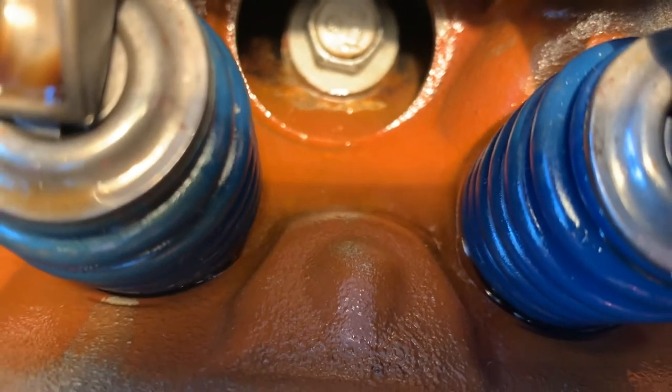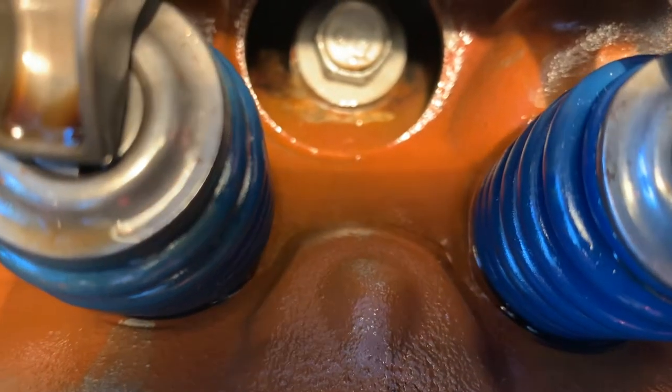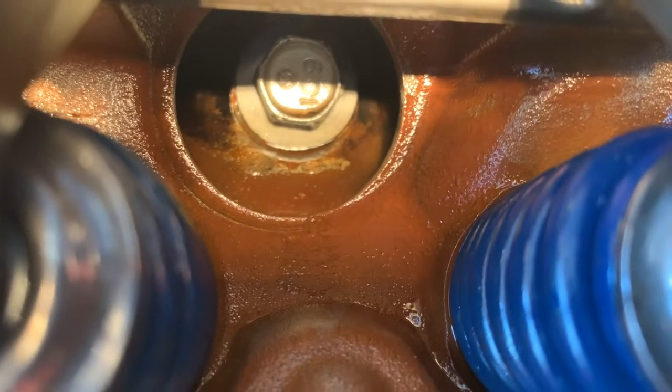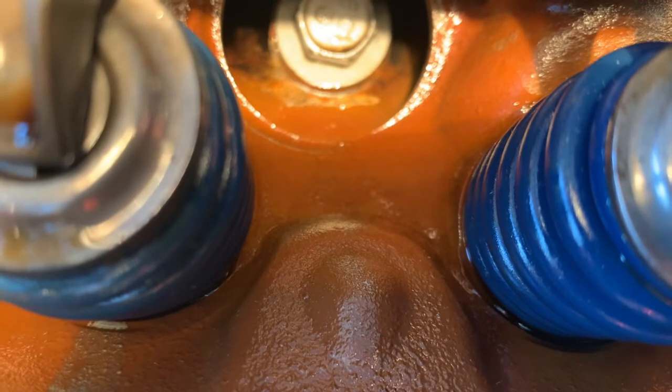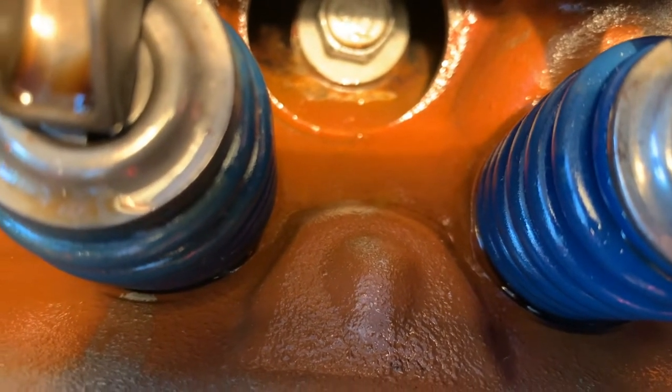I didn't see any drops on the passenger side, and that's the side I was blaming it on — I don't know why. Glad I took the valve cover off and looked, because this is the worst head of the two. The other head looks really nice. When I pumped it up to 15 and 16 psi — the cap pressure for the system — it immediately started trickling. I saw a shiny spot down in there: that's clearly a crack.